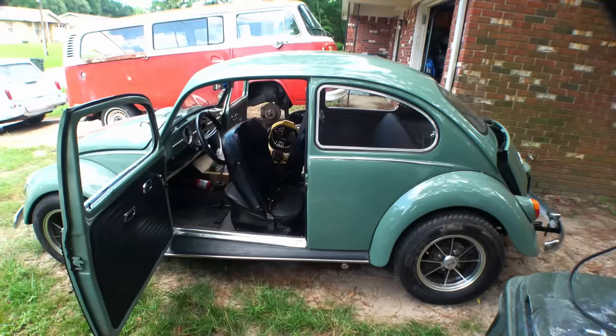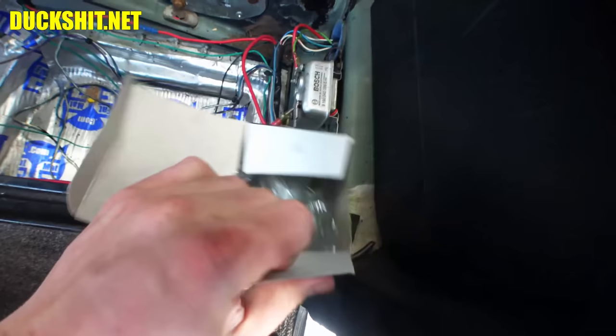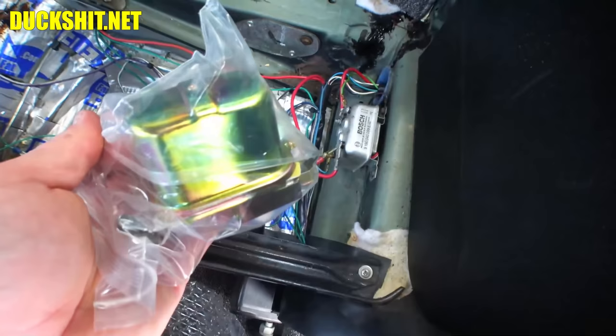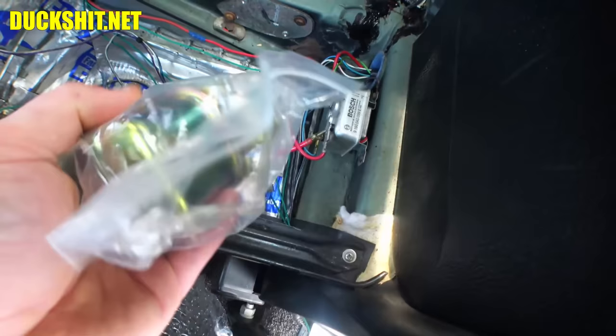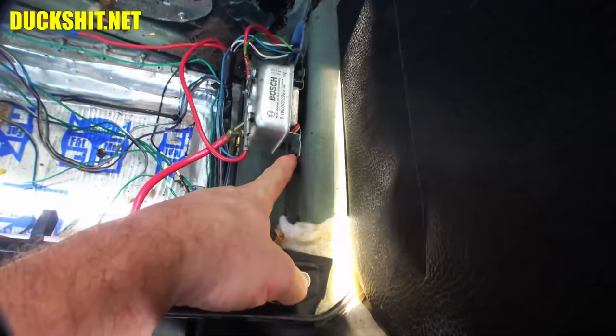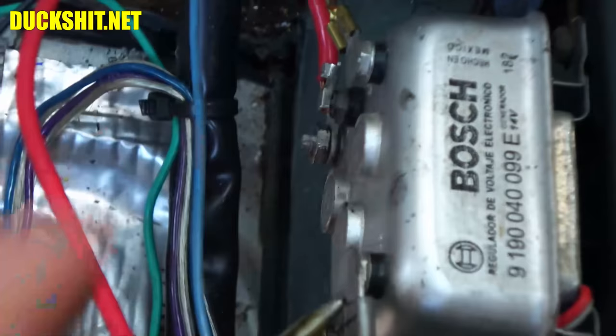Right down here is where the voltage regulator lives. Here's the new piece that we got — we picked this one up locally. The reason we got this one locally and not the exact same Bosch solid-state one is because these are relatively inexpensive, easy to come by from local parts suppliers, and they actually have a lifetime warranty on it. Which means you can pick this one up just about anywhere and it's free the next time it goes bad. We're going to replace it today, starting by disconnecting the battery — the negative is already off. Looks like this one comes out with Phillips-head screws. Here's the nut that was loose in the last video. The rest just unplugs.